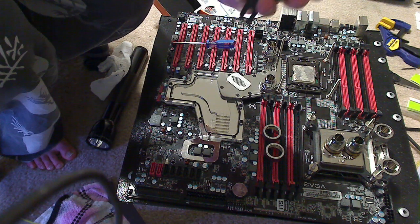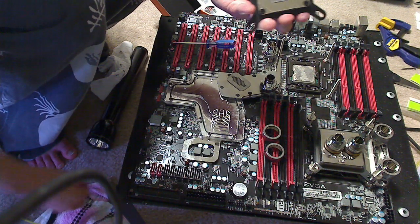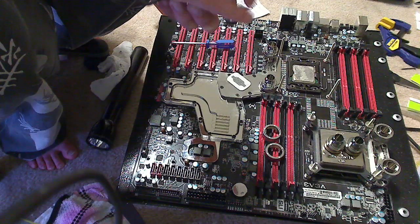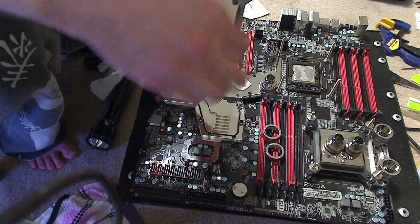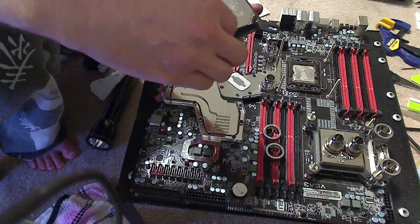When you buy these, you probably don't need to ever remove this unit because the flow plates that come on it are decent enough for most applications. But when you're cooling two processors and a chipset, you really need to change the flow plates.